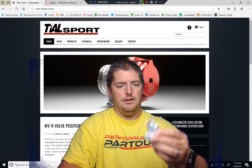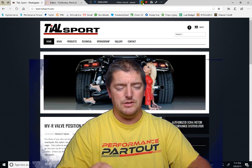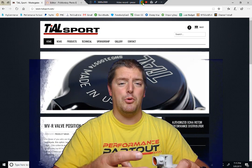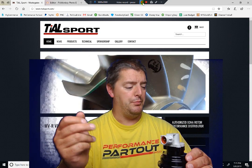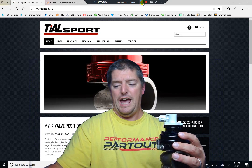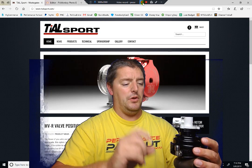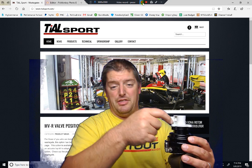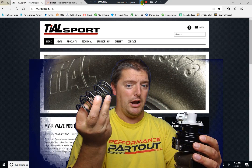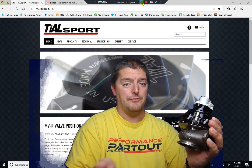This little sensor is going to tell us the position of our wastegate. This is useful for diagnosing things — in our application, I believe the wastegate might be blowing open. We use a three-port solenoid and we've run boost pressure directly to the bottom port of the wastegate. On the old hat, we ran a solenoid valve to the top. So when the solenoid is at zero, you're getting boost pressure to the bottom but nothing to the top, so it just blows the wastegate open. That's your minimum boost pressure — which should actually equal the spring pressure, the spring pressure equal to the valve area times your exhaust back pressure.